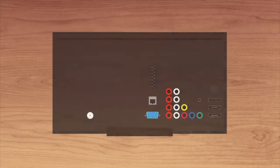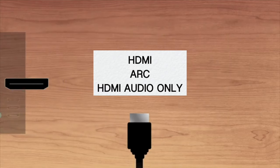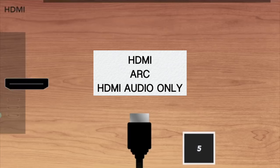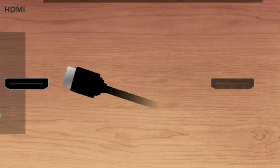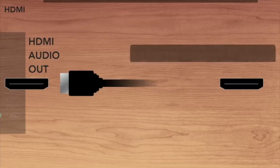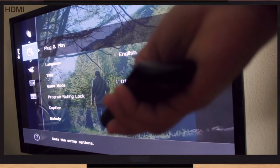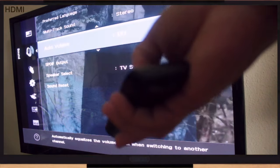Let's move on to the other digital connection which uses a typical HDMI cable. This connection is also known as ARC and HDMI audio only — your TV may also refer to it as HDMI audio out. Once you're all plugged in, plug the other end to your sound system. When it comes to speakers, I've only seen sound bars equipped with this port, but check the back of yours to see if you can plug in directly. If so, all that's left is selecting the correct audio settings in your TV's menu.